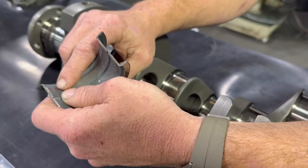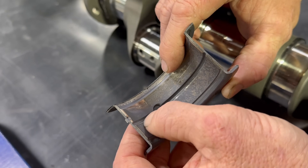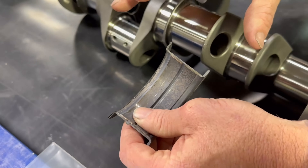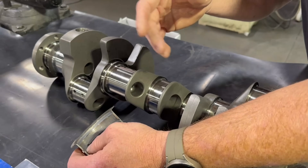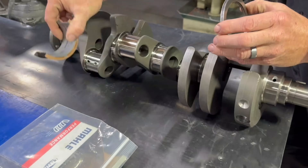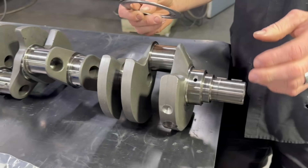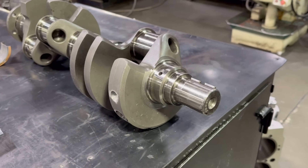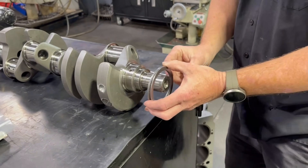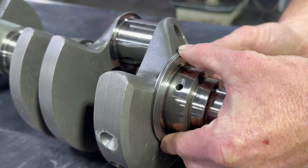You're doing a little extra oil groove here so that oil comes out of your block into this channel, goes up and aids in extra oil on your thrust side — that's good. We still do that in most motors we build here in-house too. What's going to happen now is we'll have a new thrust bearing in here, and then we'll have our roller thrust. What we've done is machine the crank and machine the block, and we're going to set this roller bearing system in there so you have a race on both sides of the roller.